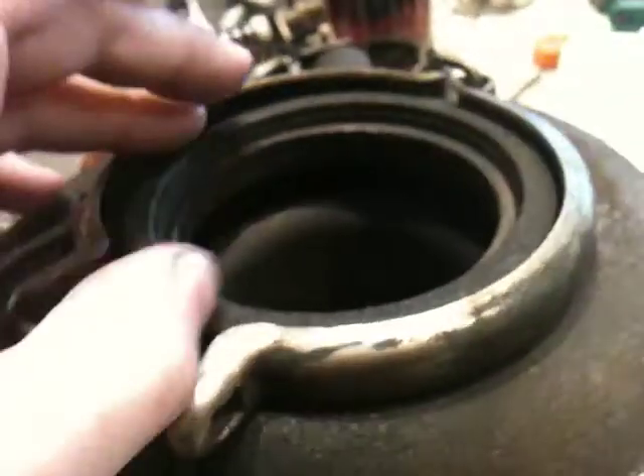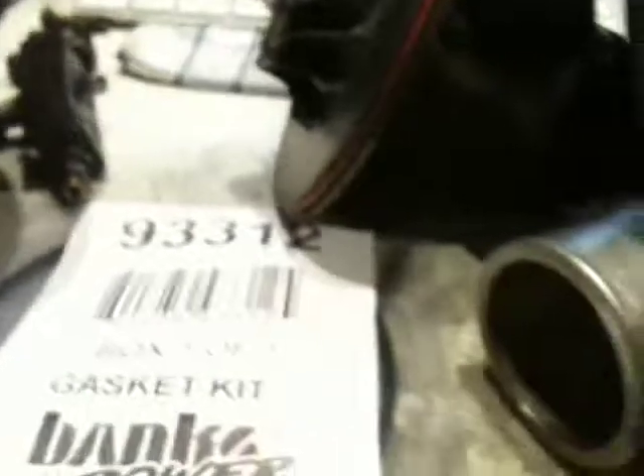That's about all I'm going to do before I reassemble it. The exhaust housing — I'll probably try and clean up the mating surfaces here around where it connects to the CHRA, just so that I don't have any leaks because there's chunks of carbon and exhaust gunk in here. I might even clean up the exhaust side there just so I have a good seal when I install this turbo. I don't want any exhaust leaks because that will lead to reduced boost pressure, and installing and uninstalling a turbo is not something I really feel like doing — it's kind of an involved process.